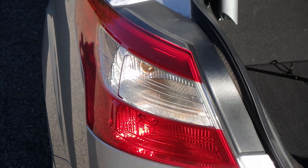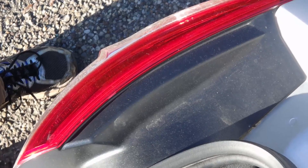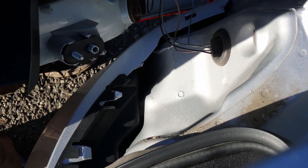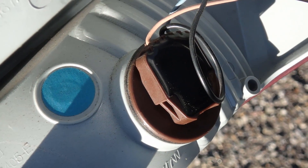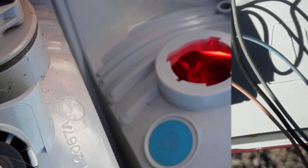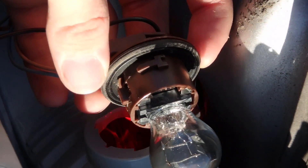Once you remove those two black screws and bolts in the back, the tail light will just pop right off. Once your tail light is popped off, we will be removing that brown cylinder. The back of the light looks like this. We're going to remove the housing right by the blue circle. Once that's been removed, it just twists and pulls straight out — that's your bulb right there. Go ahead and pull the bulb out.